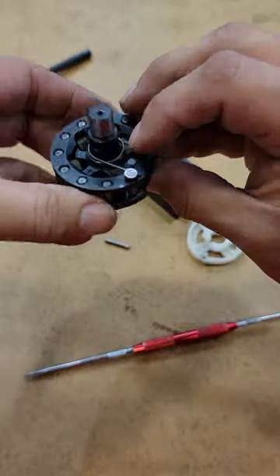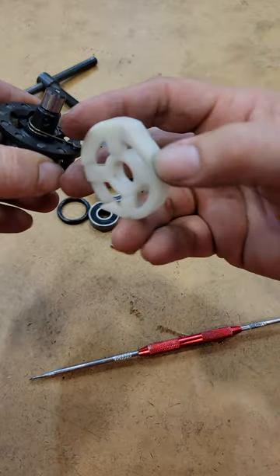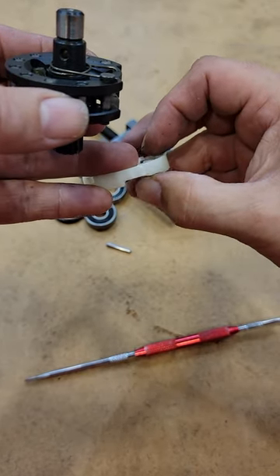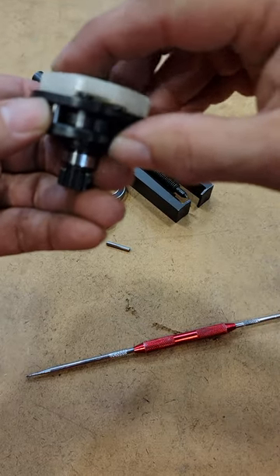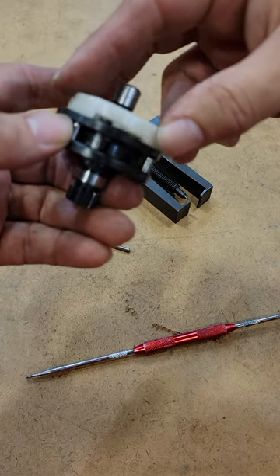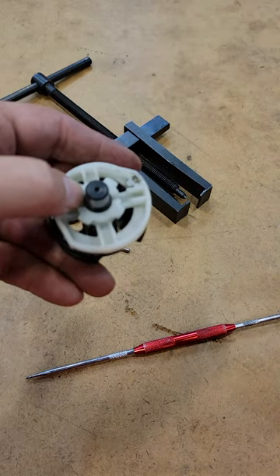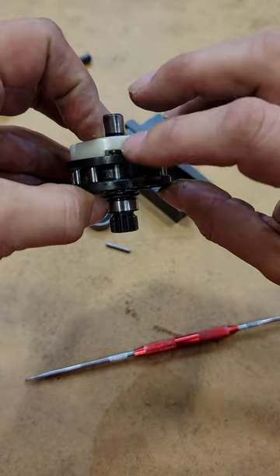Now the positioning sensor — you can see it has a groove. That groove is going to go over the number one pin. If you put it anywhere else it won't fit properly, and the positioner won't tell the tool where the driver is — it won't indicate the correct position. The deepest part of that groove has to go over the head of the number one pin.